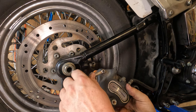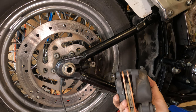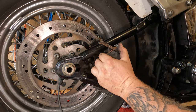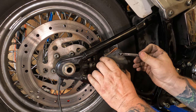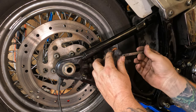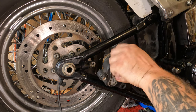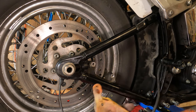To remove your brake pads, take a quarter inch 12-point socket — it's very important. Break the bolt free. We'll take a screwdriver to help. Just make sure you don't torque the brake line at all. Then take a quarter inch 12-point — a ratchet would probably be better for this. Unscrew these out of there. Pull that pin out and set it in a safe, clean location. Then you can take your brake pads out.